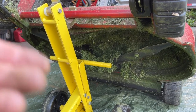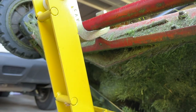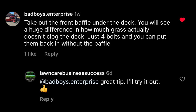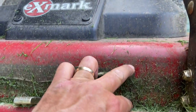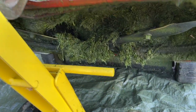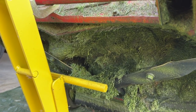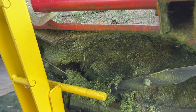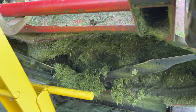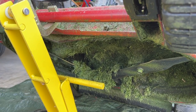I posted a picture of me doing this last week and somebody mentioned removing the front baffle on the eXmark Commercial 30 — said it would minimize some of the clogging and it's something they do all the time. It's just four bolts. Looking at it underneath, it kind of makes sense: that baffle is there for the mulching aspect, to get clippings to recirculate, whereas when you're bagging you want all those clippings to flow out into the bag. So I'm going to clean out the deck and then remove that baffle.